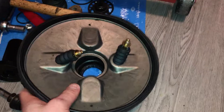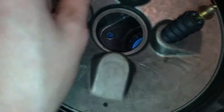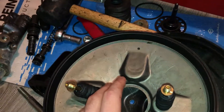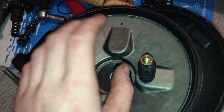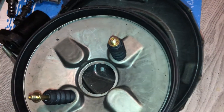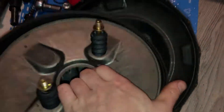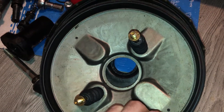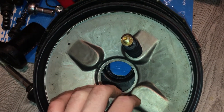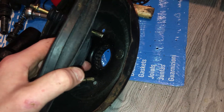The only other thing I couldn't make sense of in the video were these two holes here. I'm not 100% sure, but it seems like when the brake booster is completely relaxed — engine vacuum on both sides, not pressing the pedal — you have the potential energy stored in that big spring pushing this in, and that's going to create a seal. When it starts to move forward away from the rubber diaphragm, there's going to be an opening, which allows a little bit of engine vacuum to get through to the other side — probably just to prevent damage or rupture. That's an overview of the brake booster. It's a lot simpler than we all thought.